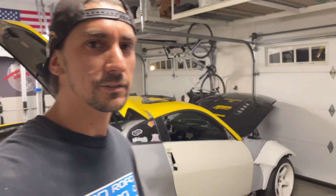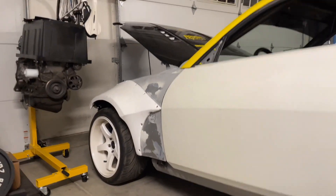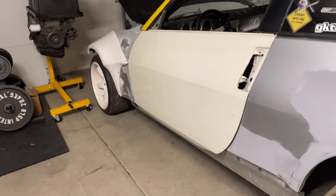It's been a couple hours and I set the camera down and got to work. This side of the car is done — fender's on, looks great, fits great. Other side, same thing. Got the door all buttoned up, it's working, the latch is functioning, and the fender is done. Looks super cool. I'm really happy with how that turned out. I wish I could run bigger spacers or more negative offset, but this car already barely fits on the trailer, so we're going to leave it as is. The door doesn't quite fit perfect — I think the frame where the hinges are is just slightly tweaked — but it opens and closes perfectly fine. It may get bashed in again, but I did put a good amount of work into it.